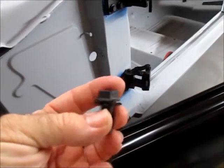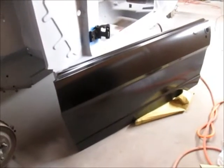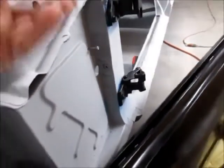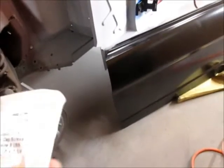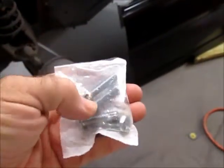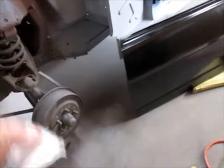This will have some top coat blue later on. Here are the new doors — I got two of them from Mustangs Unlimited. I ran into a problem because the original bolts, which have a 9/16 head and 3/8 threads, won't fit — they use a smaller thread in the plate. So I picked up some Grade 5, 5/16 coarse thread about the same length, and I'm going to add a lock washer and a flat washer.